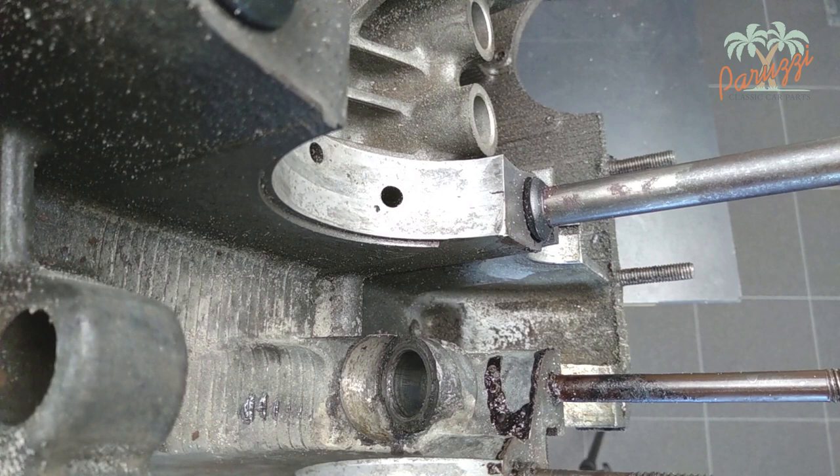You may well end up with different values for your engine. If the crankcase has ever been overhauled, it may be that the surface on which the shims rest was damaged. The rebuild company will then have machined the crankcase and thicker shims will be needed. But you can quickly determine how thick the shims should be using this technique.